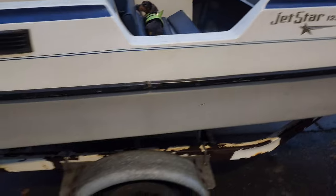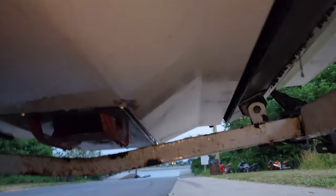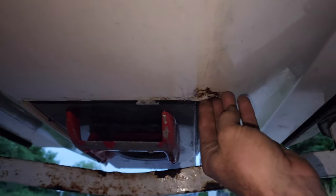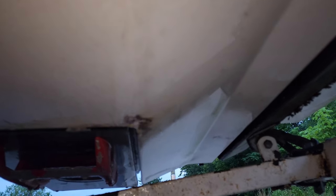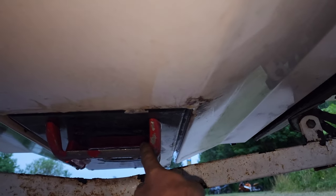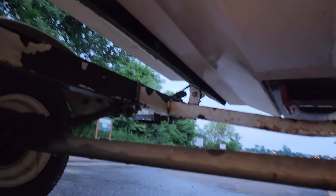I think I did find the water leak when I was looking the other day. Let me roll under here — I believe this little crack right here near the jet drive, that's like a little chip. You can see it's kind of dripping water — we did just pull it out — but I looked at this the next day after having it in the water and saw still just a little bit of dampness right here. I think that's what needs to be repaired for the water leak. Again, it's so minimal I didn't even mess with it. The impeller inside looks great. This is the intake grate — looks like an aftermarket one. And again, no rust through on the frame — usually where they would rust through is right on the bottom here and that's nice and solid.